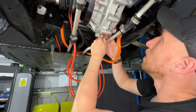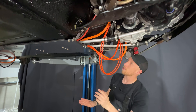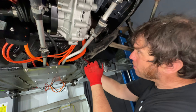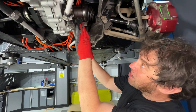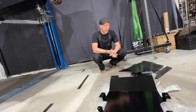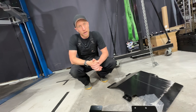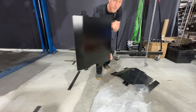We're now going to pull the slack out of these cables and get them all neatly zip-tied in place. We're adding a bit of extra protection for the HV cables before tying them to the subframe. The key thing is to keep the HV cables away from the rotating driveshaft and inner CVs. We fit skid plates to the mini — not to make them more aerodynamic, but to stop you smashing things into the floor. The system doesn't sit any lower than original, but the country roads in the UK are pretty bumpy so you end up getting scratches.